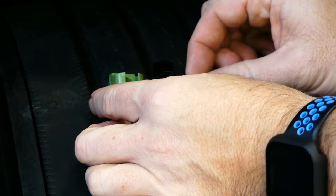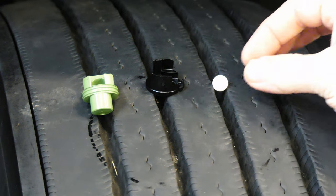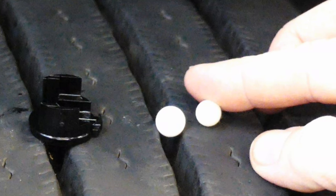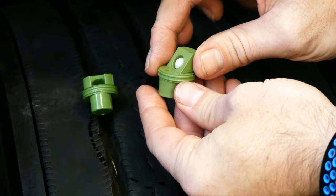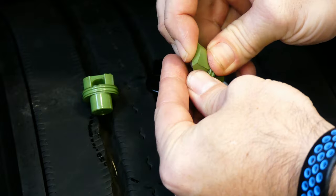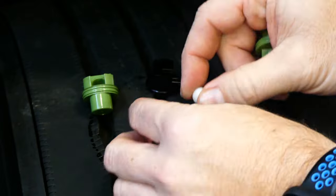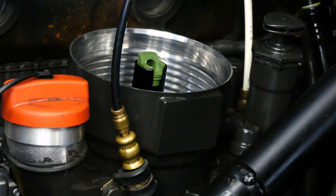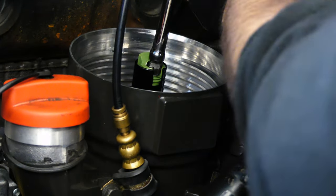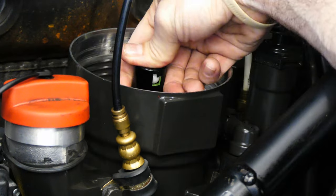You can see here that the ball is too large to fit into the opening of the valve. This smaller ball is one we removed from a previous truck — it was too small and it actually got lodged into the valve opening, so filter or no, it was always blocking fuel flow. So check your check ball every time you change your fuel filter. Reinstallation is straightforward: push the green section down firmly until it seats, place the ball in the slot, then snap the black cover into place.